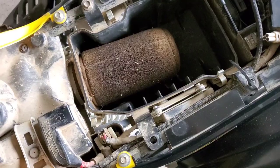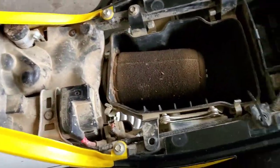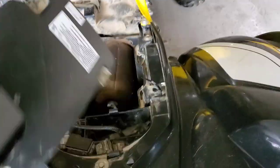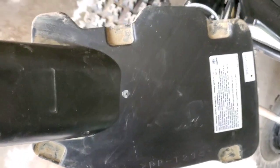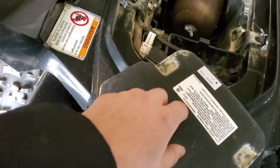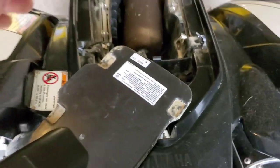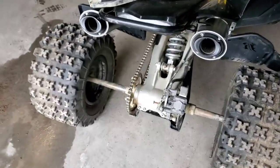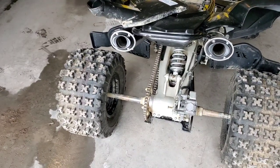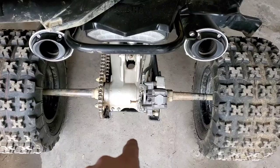We're just going to do the air filter. It's filthy — I haven't cleaned it since last year and I haven't even ridden this in months. It comes with the billet adapter plate that goes in between the box and the filter to make it fit right. We're going to get rid of this shot foam one. I got a new pod filter — the K&N high flow air filter. I might try to do something different with the airbox lid; I know on Travis's old Blast someone cut out little circles just to allow more airflow. I might consider that if it bogs out too bad, or I might just toss the lid in the trash like a lot of Raptor guys say.